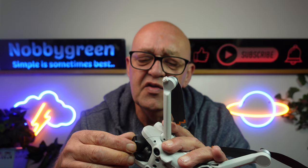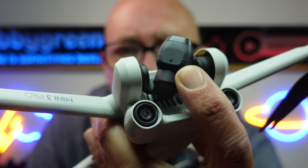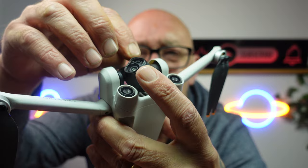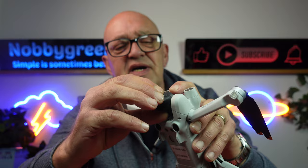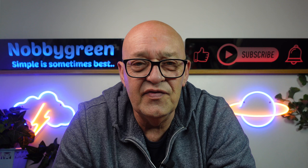There is another fix which I've seen on forums and on YouTube — it's a little bit intricate. There are two screws either side of the gimbal lens cover. If you take those screws out, this whole front comes off, and behind there you'll see there's an O-ring. If that's misplaced and it's not sitting in the groove correctly, that can also cause fogging on the lens.